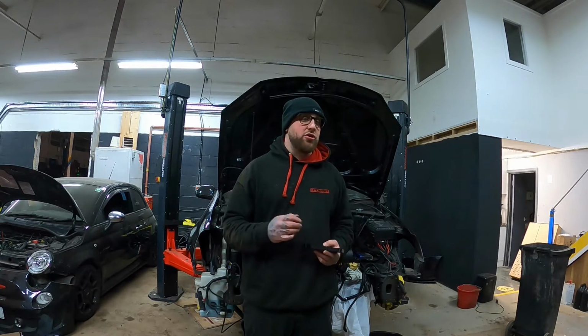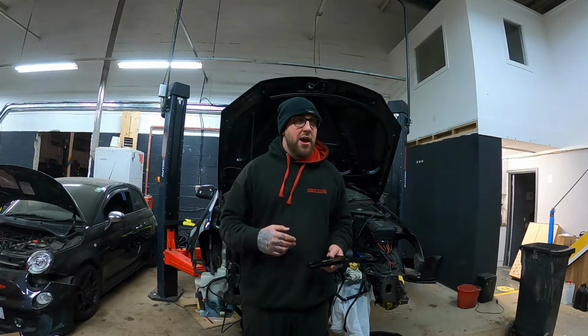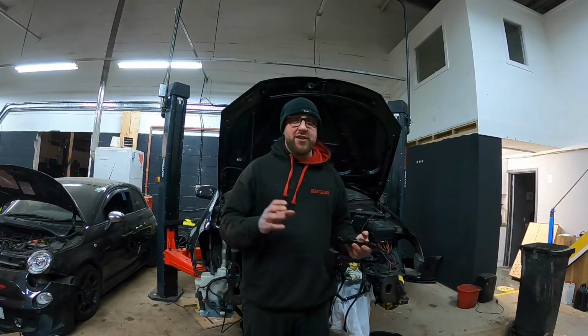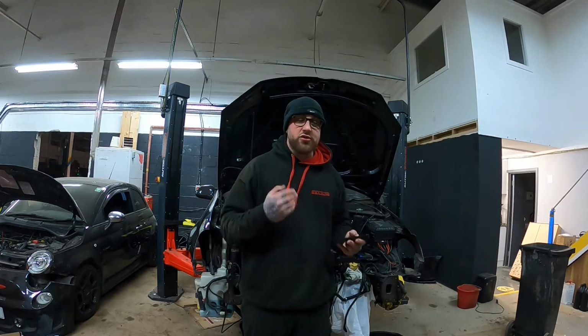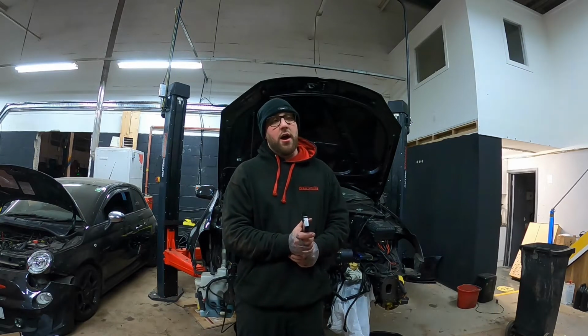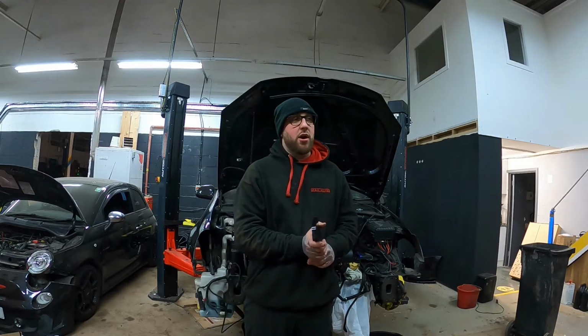And when it gets too hot, it starts cutting the clutch out and gets a bit jerky. I mean, mine, obviously being on Emu Black and having the uprated clutch pack and everything, always seems to drive better when it's cooler. When I'm really giving it something that gets really hot, especially at drag strip, it starts jerking and banging and stuff like that. So I knew the oil was getting too hot with the OEM style cooler.